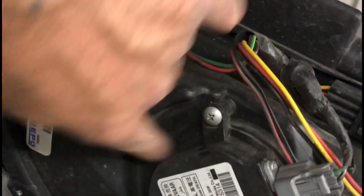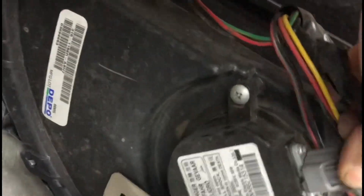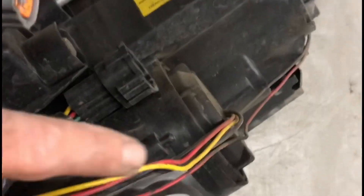Alright, now that I have the OEM headlight out — I already did one, it's inside and all taken apart — I basically want to show you guys really quick. With the OEM light, you're going to want to take off these three screws, pull this apart, there's a clip, you're going to disconnect all this from here. Take these out; there's a wire that runs through here. You have to run it all the way up there to connect to your low beam light, so I'll show you the pieces you're going to take off right now.